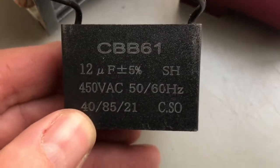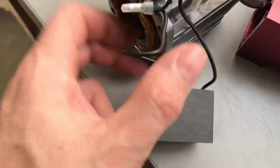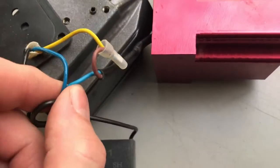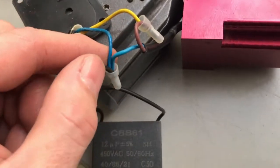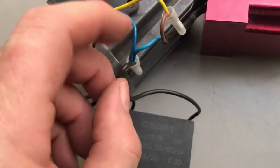This has a 12 microfarad 450 volt capacitor in a small format — that's one of the tricks to fit it in that little housing. One side of that capacitor goes to the black wire coming out of the motor. Out of your power cord you've got your neutral and your hot. One side — you could call that the hot, though it won't really matter — junctions together to the capacitor and also connects over here.